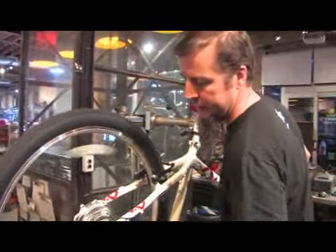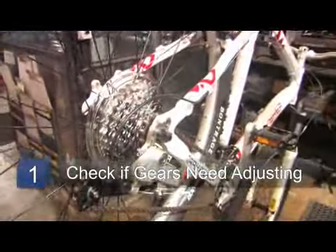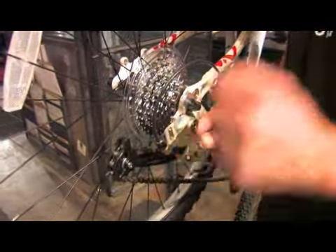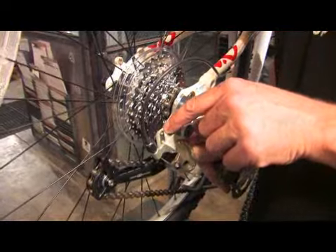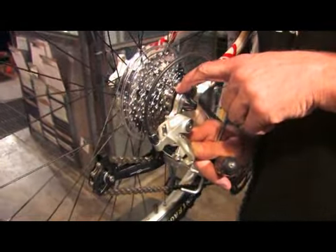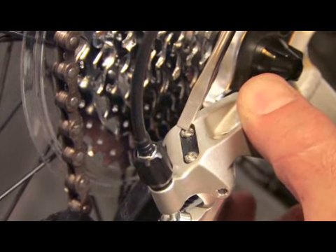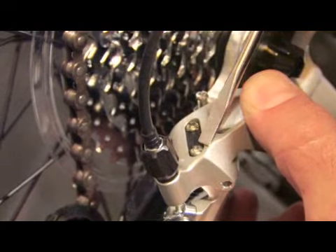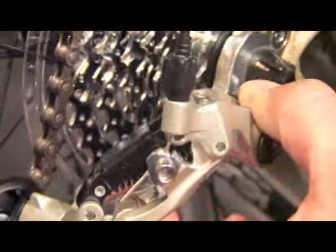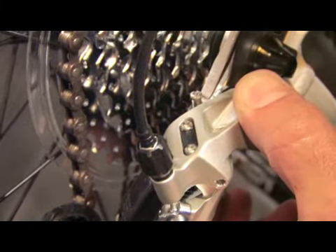You'll need to run through the gears and double check to make sure they need to be adjusted. Once you've determined that, you'll have basically four points of adjustment: a high screw — it'll have a little H next to it — that'll be the high gear, aka the smallest one. Then there'll also be a low screw, which will be your lowest gear or the easiest one. Then there's also a barrel adjuster — this is where you'll need the five millimeter allen wrench for cable tension — and then a B tension screw.